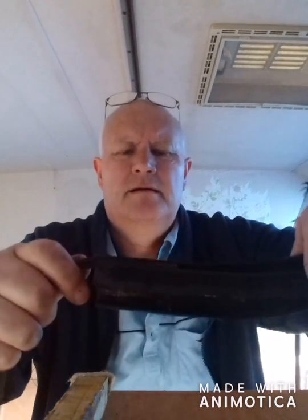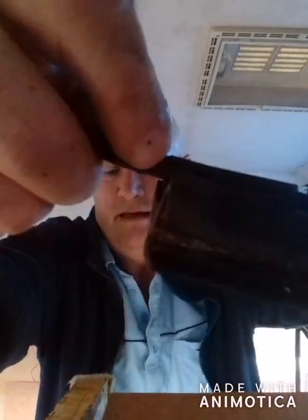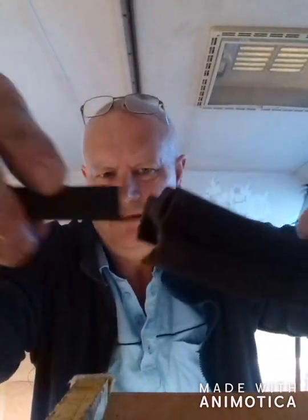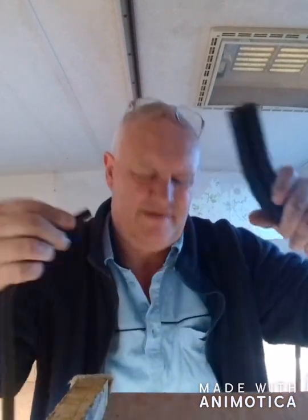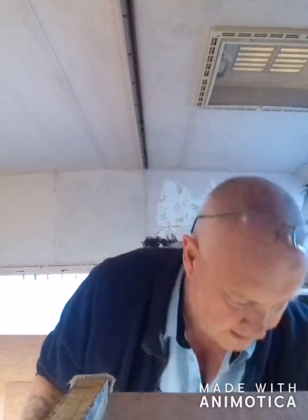Look, I'll just put it in. I don't know if you can see it or not. I'll tell you what, I'll put light on it. It goes in there anyway. Right, now before you take the rubber off, you've got to pull that out. Once you pull it out all the way around, it's basically then a case of bend up the rubber, pull the window out, and then obviously all the rubber just comes off.